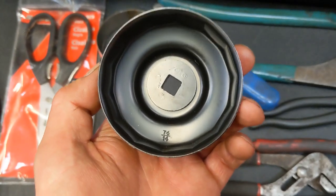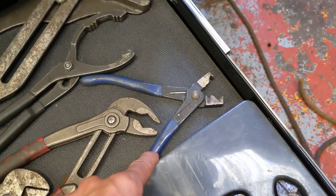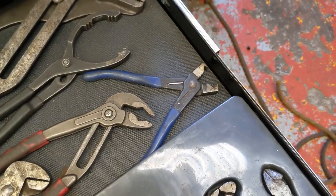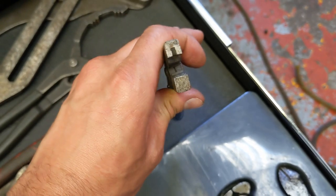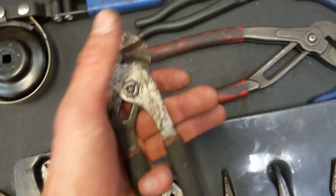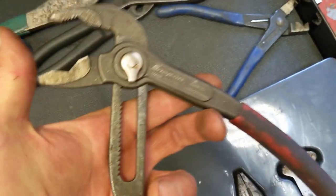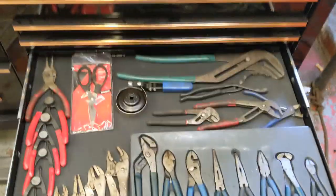It's 14 flutes, 76mm — that's the Laser brand from Halfords, about seven quid. These are a handy set of Blue Point pliers for the clips you usually find on air intake pipes, which are kind of a one-use clip without these. They're reversible — use them one way to undo, the other way to do up. Some more little adjustable pliers — I might bin these because they're not that good; when you try and grip something the jaw slips up and traps your fingers. And then these Snap-on adjustable things — I'd say I don't really use them, but looking at the state of them, I must use them.